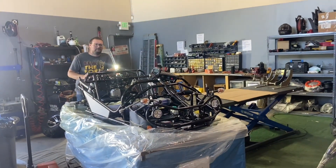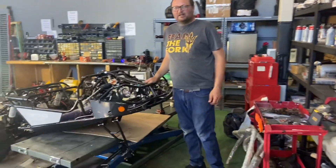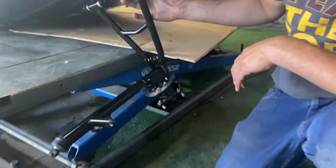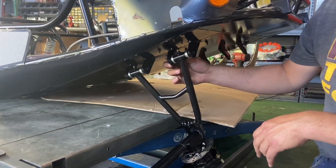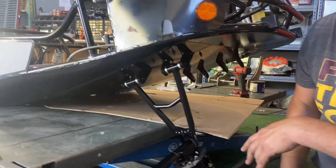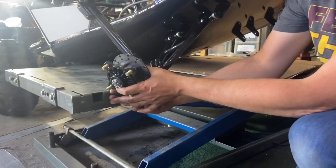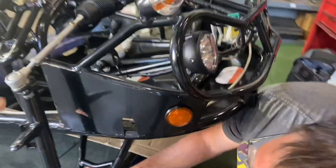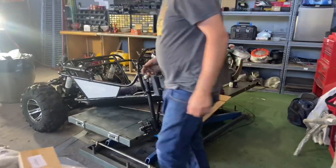Adam and I are going to lift it off and get the process going. Adam installed the rear wheels and right now we're installing the a-arms. You want to make sure you either have somebody to help you, or put some tape around the copper pieces that spin around because they will fall off on you numerous times - grease or tape would help. Now we're doing the spindle - got the lower control arm and spindle - and you connect this right here onto this.